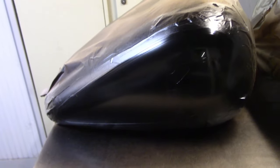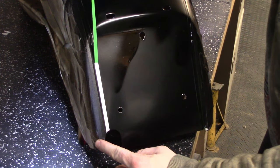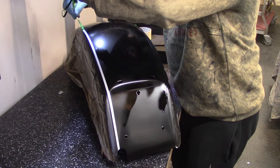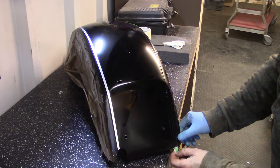So directly after I applied that fine line masking tape on that silver to shield it, I went ahead and covered the whole thing and sprayed some black on it, as we're gonna have two-tone paint. So the red is a base color, then there is a fine line of silver, which I'm just unmasking right now, and inside is gonna be black with some patterns on it. I believe that's called reverse masking.